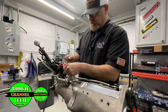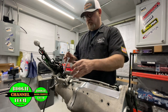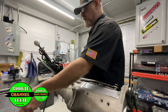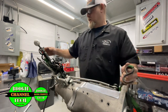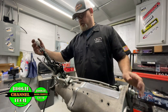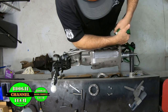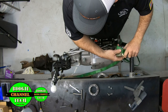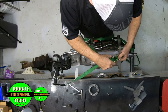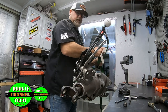So you get the gist of what we're doing here — you're going through each gear and setting the slider depth into the dog ring with the stops of the shifter. That's just what you've got to do. You're going to walk through this process all the way from third on into fourth. Of course third goes forward, so we lock it right there. Now we're in third — that works just like first.